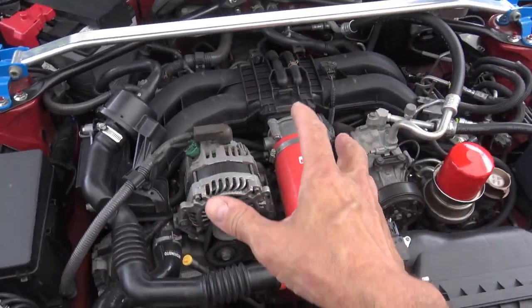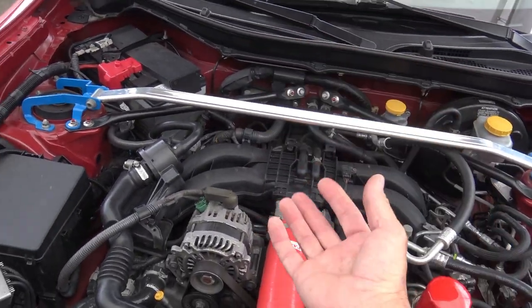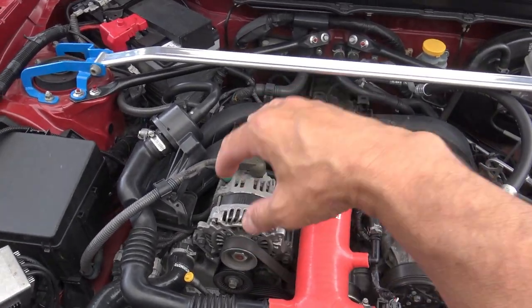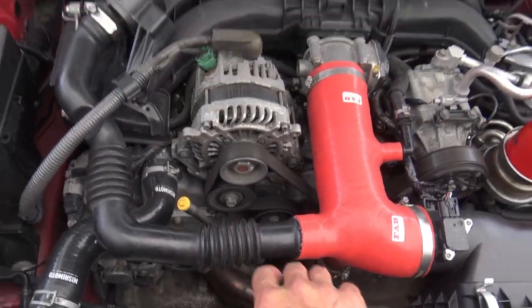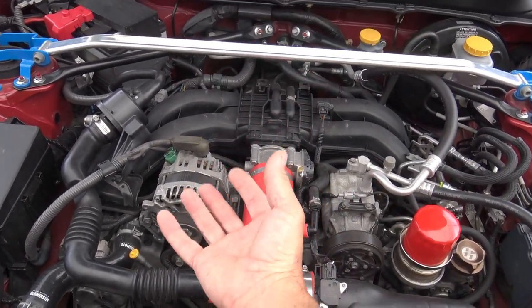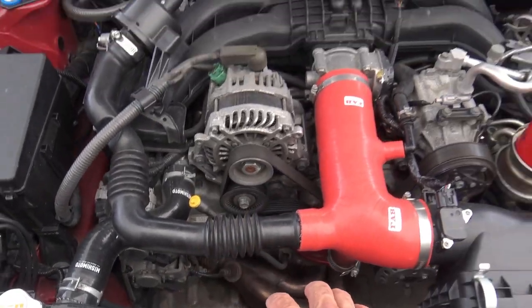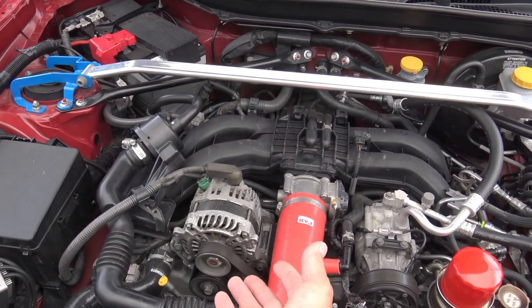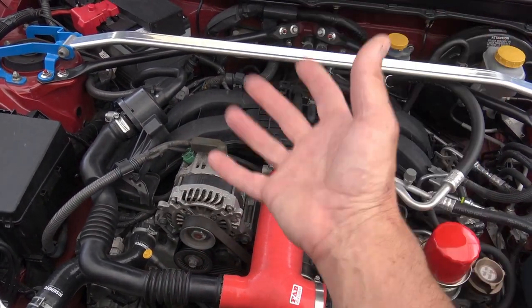Basically you've got an engine, it's running, and there's combustion gases going in and out of the cylinders. Some of those gases escape past the rings of the piston and go deep into the crankcase of the motor. All motors are like that, every single one. This builds up pressure — basically air pressure builds up in the bottom of the engine just from this little bit of combustion air getting by the rings. This is a normal process; it happens with even brand new cars.